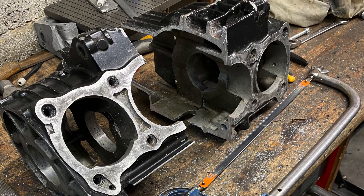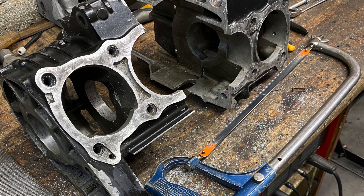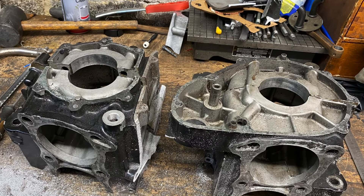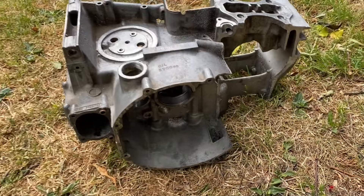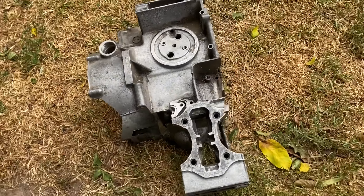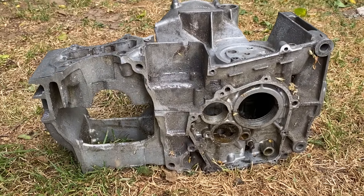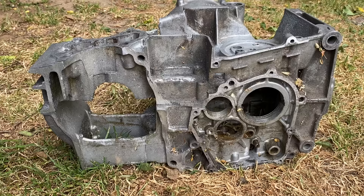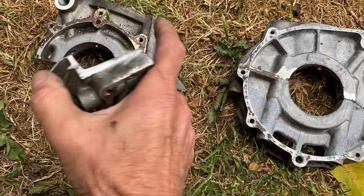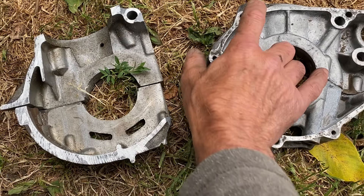With the first set of crankcases cut, this is all I need — the rest is sadly scrap, although I do keep them just in case I need to repair other crankcases with the parts. Here are the outer crankcase parts bolted together ready for milling, and here's the central part that I no longer need — you can see where the cuts were made. The two ends, left and right, could be useful for repairing other engines, or perhaps I could weld them back and make a nice parallel twin, but I probably won't.